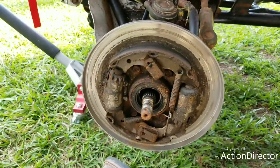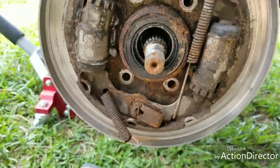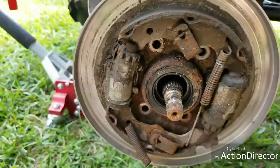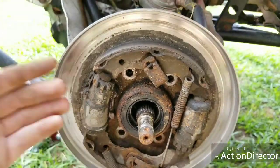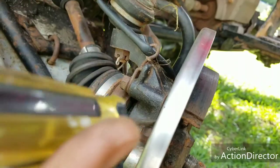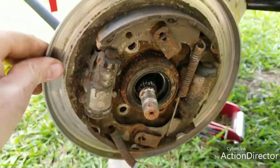Got those off. It should come off pretty easy with some PB Blaster and a screwdriver to pop the dust cap off. It should separate - if there are any other bolts I'll find out when I start prying. On my other four-wheeler the Rincon 650, it would just pop off after the four bolts. Going around with a flathead and tapping with pliers - it's popping loose. You have to go all the way around until it fully comes free.